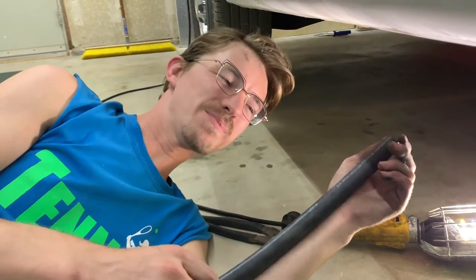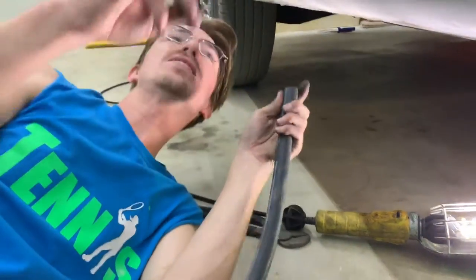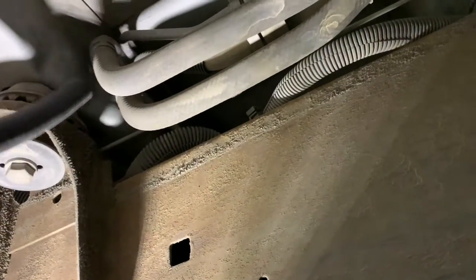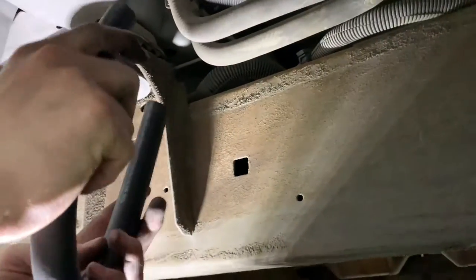Hopefully 2019 me was able to help out — if not, sorry, I know it was a little goofy. Anyway, let's jump into the heater core bypass. It's much easier than the air conditioning. The rear heater core is pretty easy to bypass. All you need is a 5/8 inch heater hose, maybe a little over a foot. Here's the edge of the driver's door right here, and just a couple inches back from that down along the frame rail, all you have to do is undo these two pinch clamps.